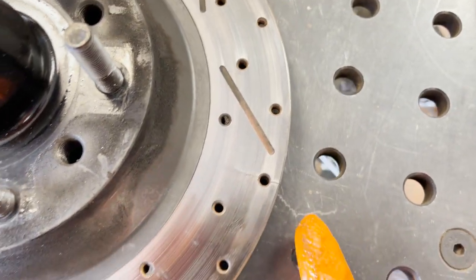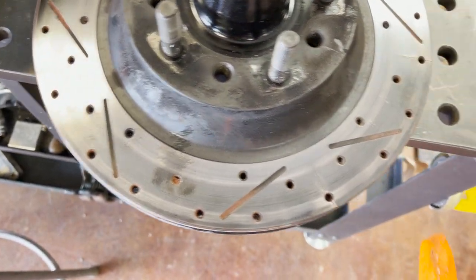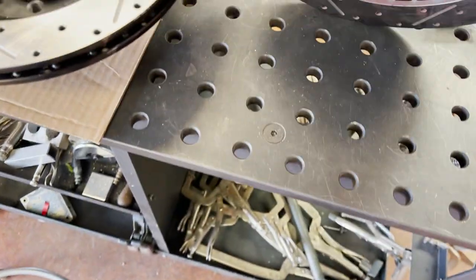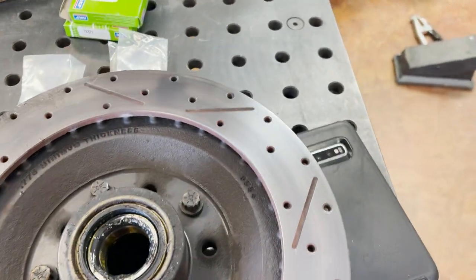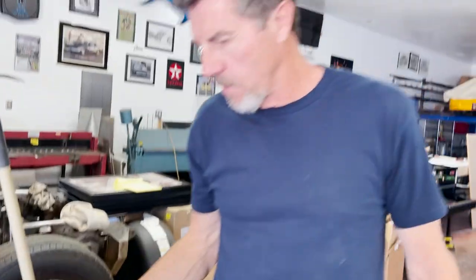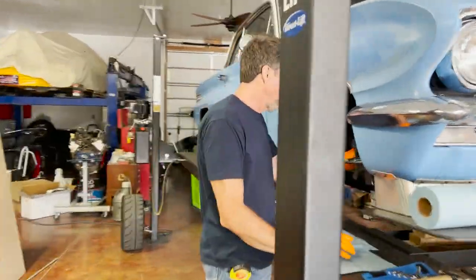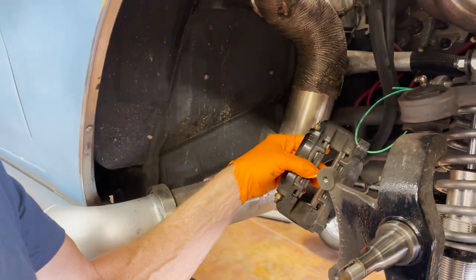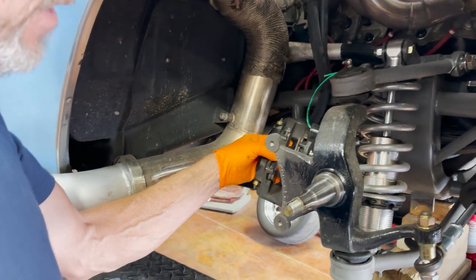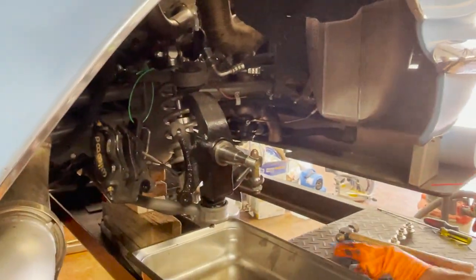This one's off now. You guys can see where it was starting to crack pretty bad on the outer ones - that kind of sucks. The inside ones look pretty good, I don't see anything on the inside. That was because of the air getting to it, causing it to cool down more quickly on the outside - kind of quenching it more. The inside is getting rubbed the same but the outside is cracking more. It's interesting, just kind of different in the whole way things work.